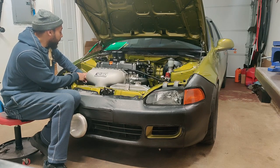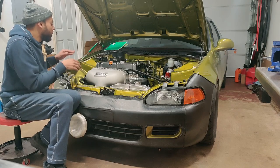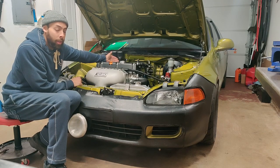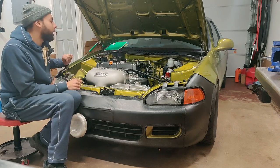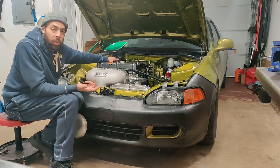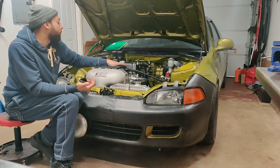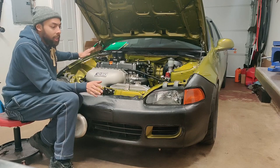I already have two sources of pressure going to the oil catch can through the PCV valve. It's definitely breathing out pressure, but there's no moisture or condensation leaving out of there — if I took the line out right now it's dry. You don't just want to get the air out, you want to get the moisture out of your engine. It looks milky in there, like you need a head gasket, but it's just moisture and condensation leaving out of the valve cover. That's why most K-series guys tap in two 10AN fittings from the front or back of the valve cover.